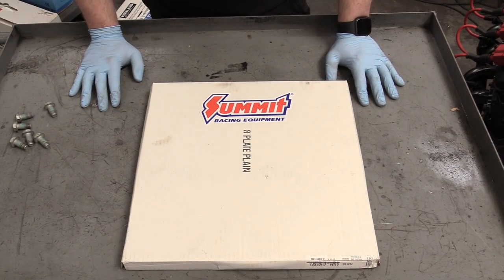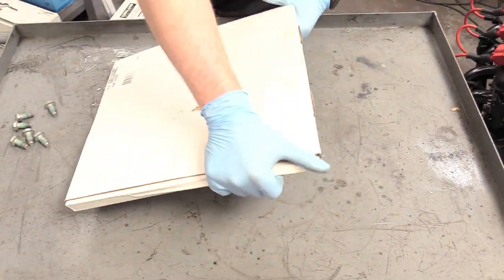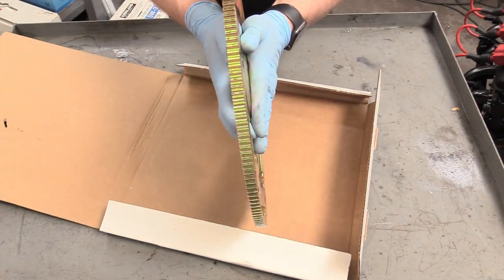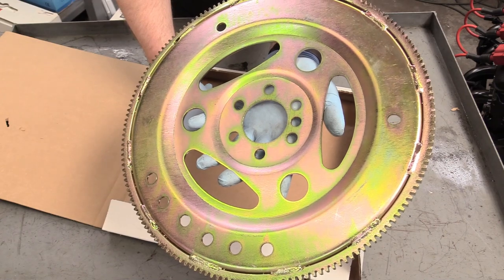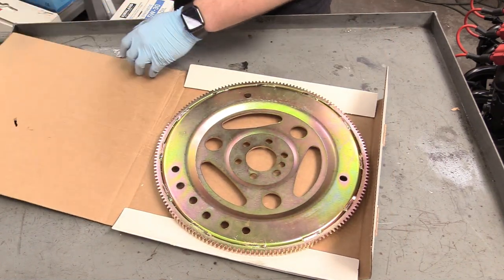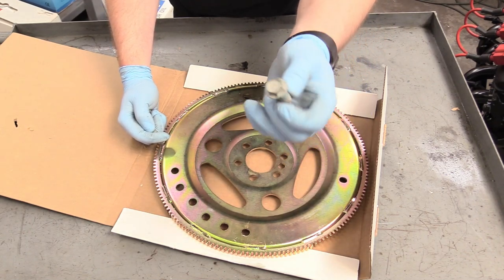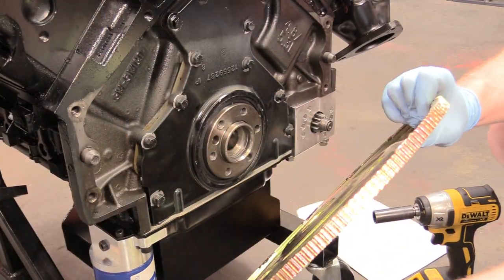For the last piece we will be bolting on before going to the dyno shop: our Summit Racing branded flex plate — link in the description. There are two things you need to know. See this beveled raised edge — this beveled edge needs to face your crankshaft. And there's an additional hole where three holes line up in a row, just like on the end of the crankshaft — you just have to line it up there. To affix this to the back of the crank, remember from episode one or two I said to hold on to those special bolts — well here they are. These are new ones purchased at a GM dealership — they have the new blue Loctite coating. You need these exact bolts, no substitutes — link in the description.